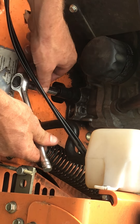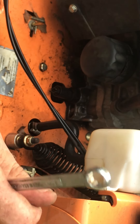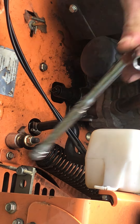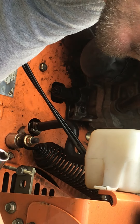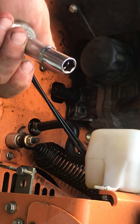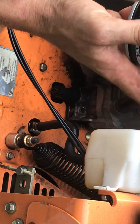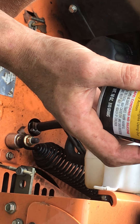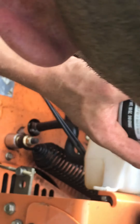Be really careful. I started with a 10-millimeter wrench but went with a 6-point socket, because 6-point sockets have less chance of stripping. I used a little PB Blaster — any bolt that's having a problem, you want to put this on, let it sit for a minute, and then try. That's pretty much what I did and it worked.